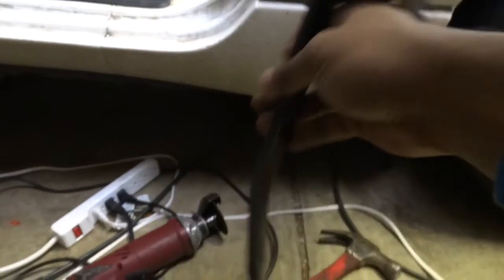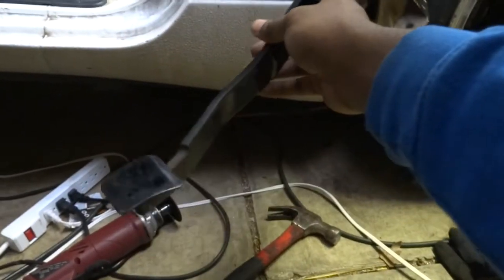So I ended up ordering this brake pedal right here, which is a stock manual brake pedal assembly. And unfortunately, I learned that in order to change this, the brake booster has to come out, which is a pain to get out. So I'm gonna drop that right here because I'm not gonna be using it. I ordered that, didn't need it because I wasn't gonna change it. It's easier to just cut your stock automatic brake pedal, and that's exactly what we just did, or what I just did. So let me bring you guys in here for a hot second, let you see that.